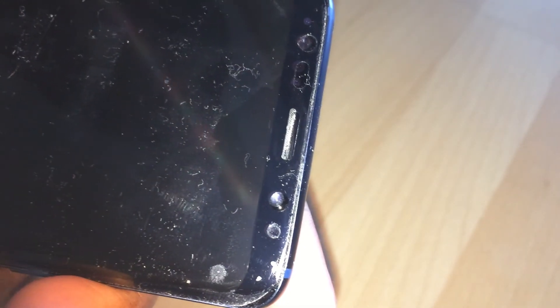If you puncture that screen you're going to destroy the earpiece, so gently rub it so the alcohol clears the dust. As you can see, you couldn't even see it before — it was so dark with so much gunk buildup. Now with the light on I can clearly see the silver screen that's there, and that's what was preventing the sound from coming through. This applies to pretty much any phone that has a screen like this, not just Samsung. I hope this helps, thank you for watching.